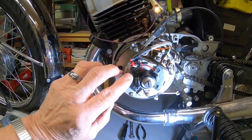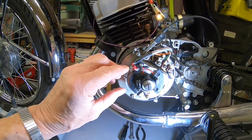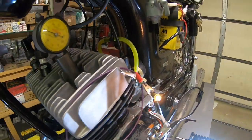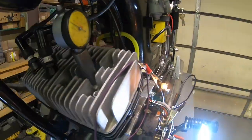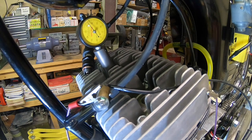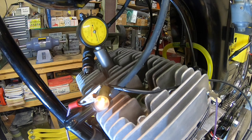So we set this up over here and adjusted. I adjusted a little bit here but I mostly just did this one. Now on the right side, any adjustment will have to be done here because you want it really close. Let me get set up for the right side. Again, we're going to go to top dead center. I'm going in the direction of engine travel and I'm zeroed out. I'm going to go back the other way. There's one, and there's eight. A little past it. Now we're coming back — keep an eye on the light. Right there. That's exactly on there. So we're right at 1.8. The left side is a little bit off but not overly so.